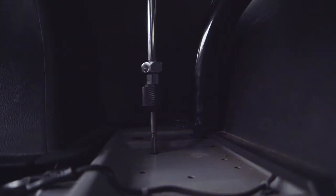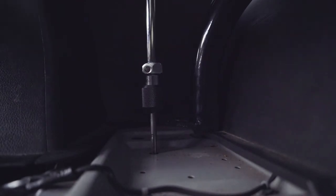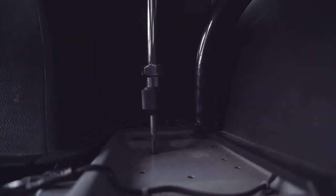Unfortunately the bolt was not going in, so I did need to tap that hole out. The tap spins into it — it's the right thread — I think someone may have previously put a bolt in there and messed up the threads. So I went ahead and cleaned that up. Once I re-tapped the hole everything went in nicely. I torqued down the bolts at the B pillars to spec, tightened the back ones down, and that thing is in there. Let me show you what it looks like on the inside with the stock seatbelts retained.